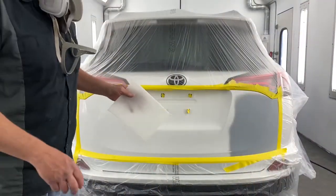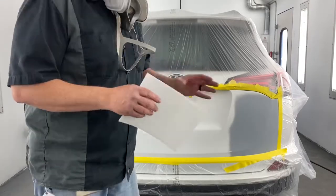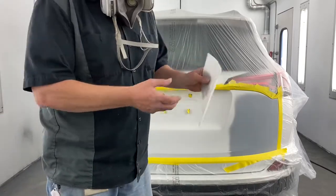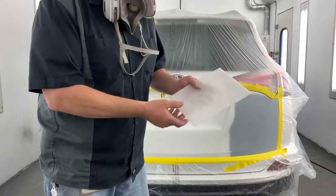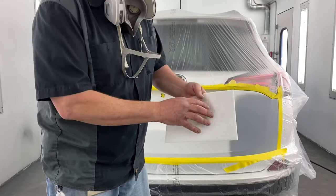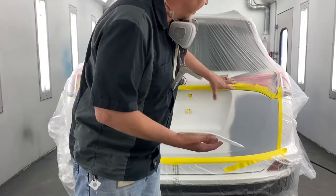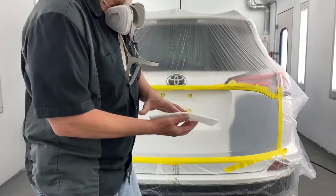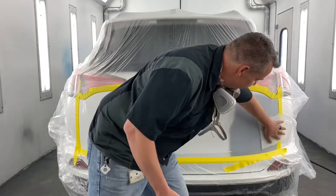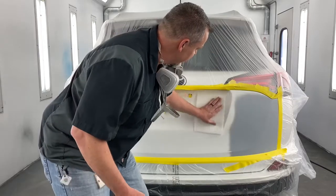Very last step before you pull the trigger on the paint gun is to tack it off. This is a tack cloth. This is not like any other tack cloth I've ever used before. They seem to work just fine, and I've got a ton of them, so until I use them up, this is what we're using. Basically, this thing is a sticky rag that gets any pieces of lint or dirt or dust particles or anything like that off of the paint. Before, this is vitally important to do. You'd be surprised, even though we use those expensive towels to wipe it down, they still have lint.